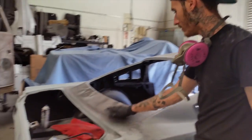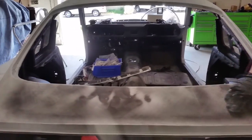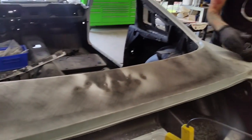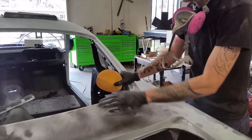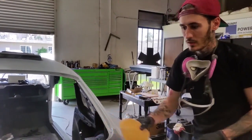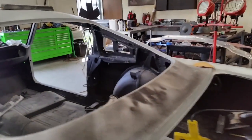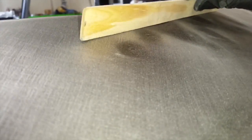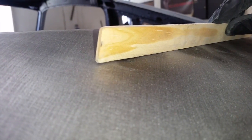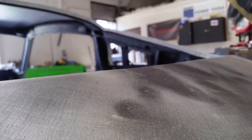Other than that, I might do this — I sprayed black on here to use as a kind of guide coat, not a real guide coat. I'll sand that off and then start doing filler on here. I got this pretty well raised, most of the way up, so we're happy with that.